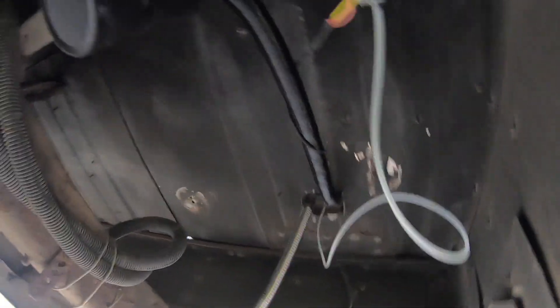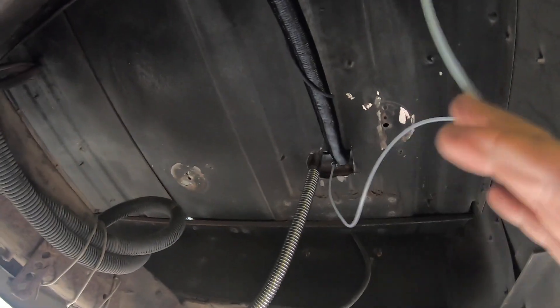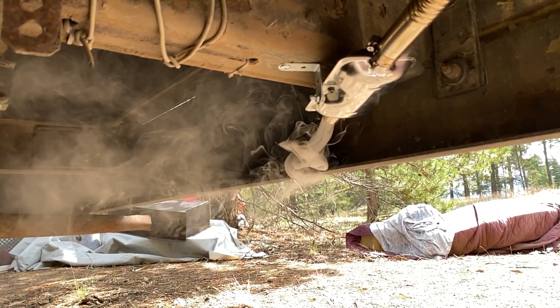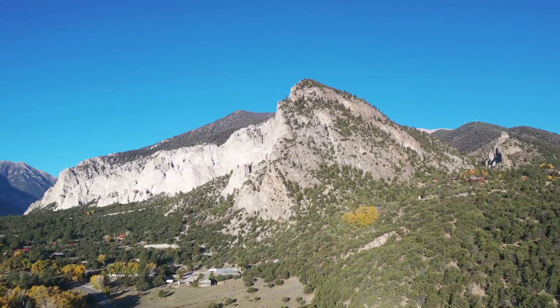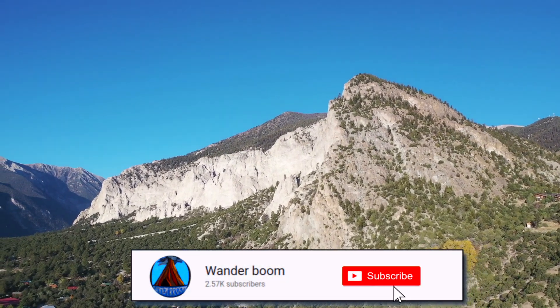As you can hear, the pump is getting louder and more consistent, and if we can get enough pushing through the line here we'll start getting a burn. This is how you do it if you want to stay warm all winter and you've got a small van, or a bus, or a small trailer, or any kind of smaller rig. These little diesel heaters are phenomenal. They sip a tiny bit of diesel fuel and they keep a space anywhere from 50 square feet to a couple hundred square feet nice and toasty.